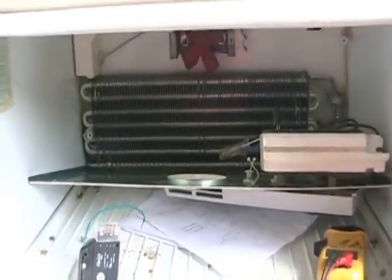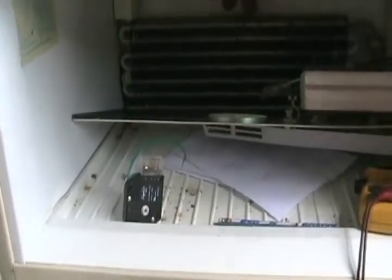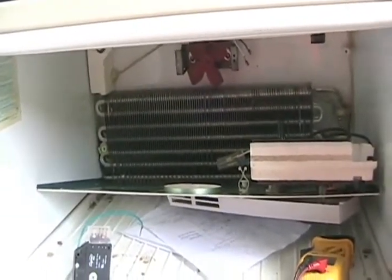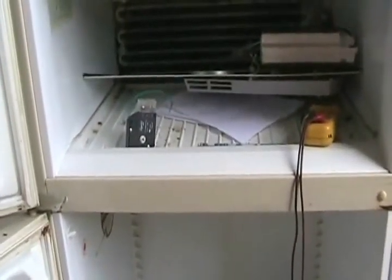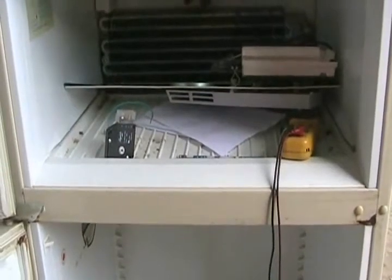After you're done fixing your defrost problem, unfortunately the fridge isn't going to work right away if it's still got all that ice back there. When fridges have a defrost problem, that whole area is a brick of ice. The defrost cycle turns on 20 minutes every 12 hours, but that's not long enough for that little heating element to melt that much ice, so it'll never get better on its own. You always have to leave the fridge turned off for a minimum of 12 hours with the freezer door open to melt that ice. If the cooling coil is between the fridge and freezer walls with lots of styrofoam around it, it can take up to two days.